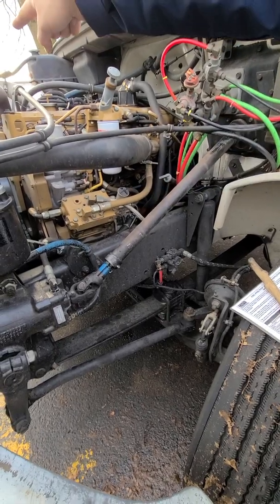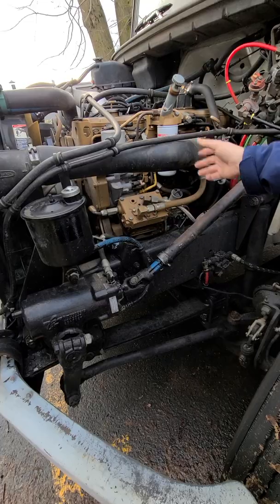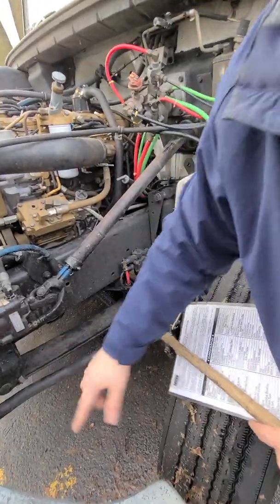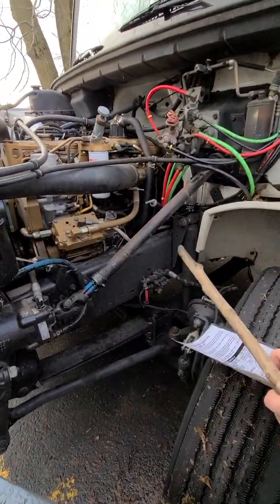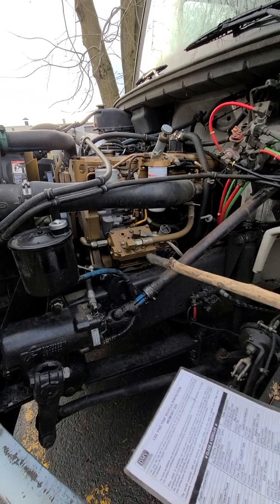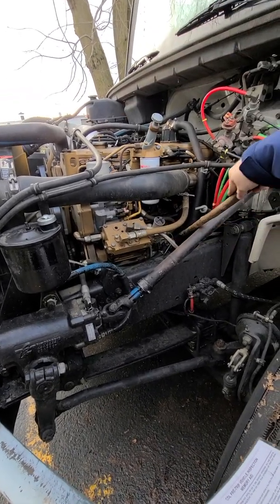On that side, alternator, water pump, and belts. Belts, hoses: all no leaks, no drips, all secure, and that's all you worry about. It's really easy. People make it more complicated than it needs to be. So you need to do three types of fluid levels: coolant, engine oil, power steering fluid. Then alternator, water pump, and then air compressor, power steering pump.